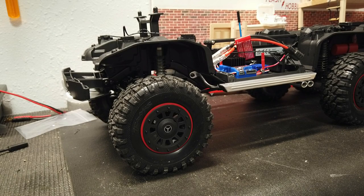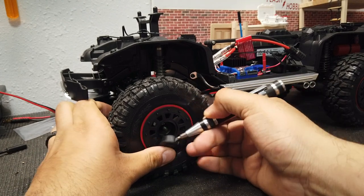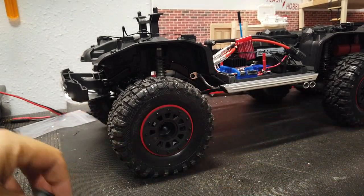To begin with this build, we have to take off the center caps off of all six wheels. I'm going to use a small pry tool here to pop off the center cap, and then you have to remove the lock nut, and then we can continue.